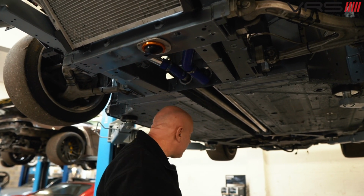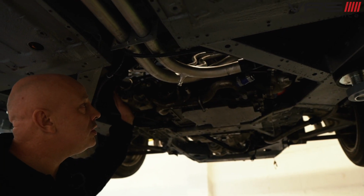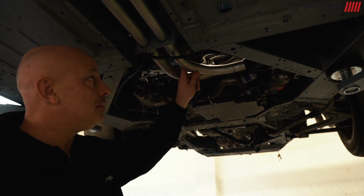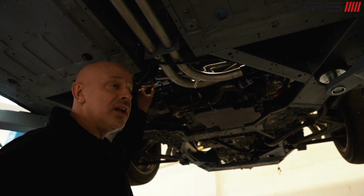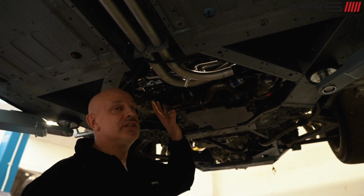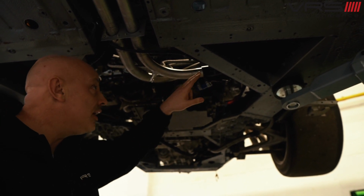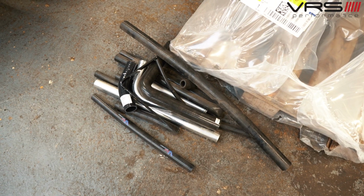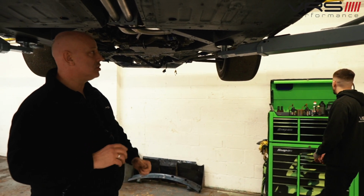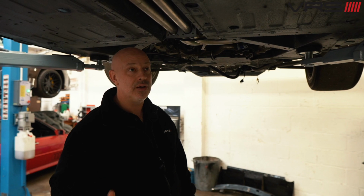And at the back, these water pipes that come down have alternator cooling on this as well. So we've added a piece in here to the water pipes. This is all going to be bolted back up, and then we'll run a pipe to that, which will keep the alternator cooling. Then we've simplified the water system at the top so that you've just got an in and out through the thermostat housing. And then we've got a couple of pipes just to add into there. We've got a little pile on the floor behind you there. So that's going to be modified, and then we'll make everything fit in, so the water system will be completely simplified for this car with one single rad at the front, as per back in the day.